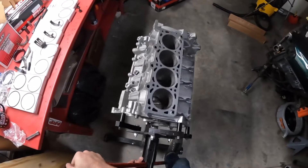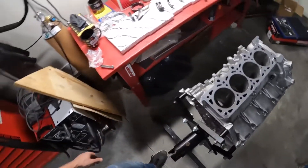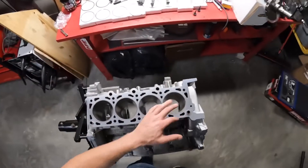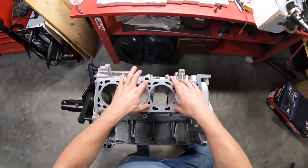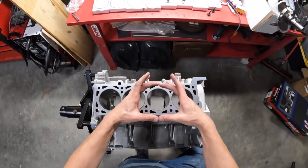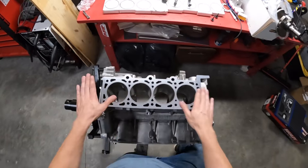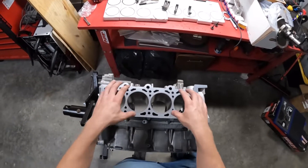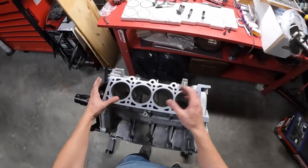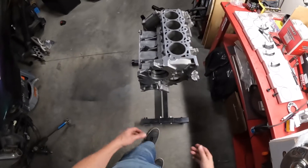The other piece I wanted to show was doing the bore measurement. The only problem is I don't have a torque plate. If you don't have a torque plate, your bore measurement is not going to be completely accurate, because when you tighten down the head hardware, it flexes the bore out of round and you hone it in that flexed state — when you loosen it back up, it goes out of round. These cylinders actually shouldn't be perfectly round right now; they'll be perfectly round when I tighten the head down with those ARP bolts. Torque plates are kind of expensive and I don't have one yet.